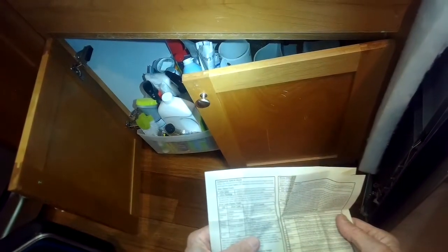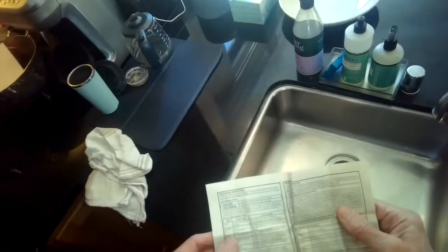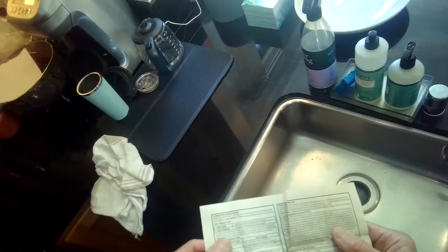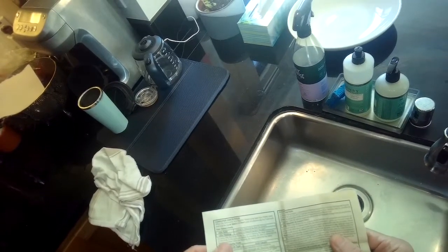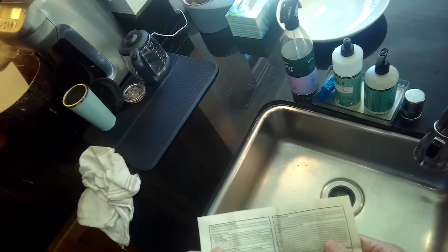Here's a little tech sheet for technicians that gives us a test to see if the computer thinks the door is locked properly. We press the cycle select button and the start button for five seconds. If all the lights blink, it means it thinks the door is open. If you get all solid lights, it means it thinks the door is closed. When I ran this test, I got all blinking lights, confirming that the controller thinks the door is open — that's why the cycle won't start.